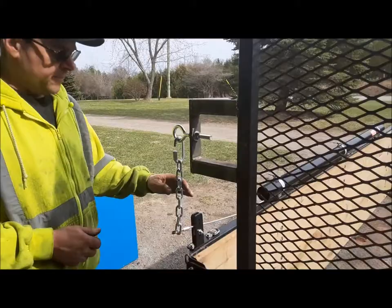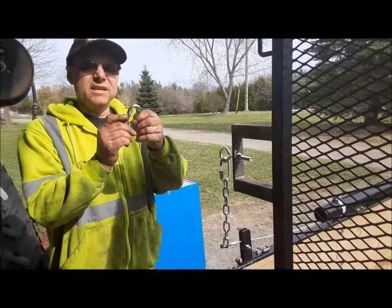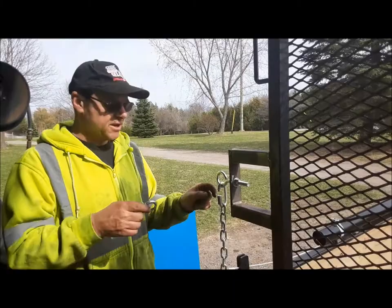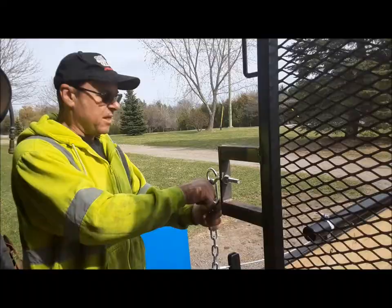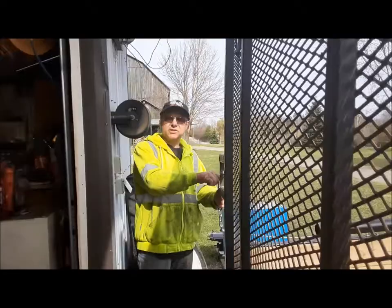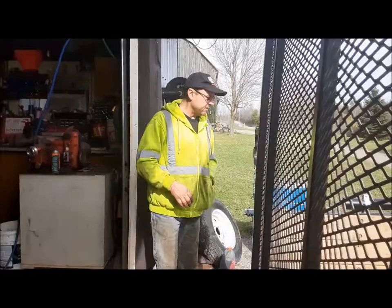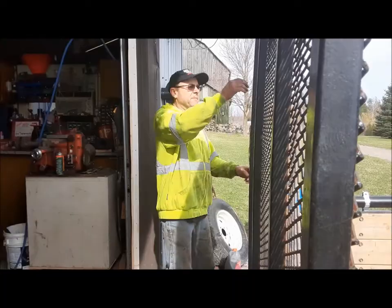We've installed the lower roller and attached the end of the chain to our eye bolt. In the kit they supply this crappy carabiner and I'm not too fond of that. At the other end of the spring they have a missing link, so I'm putting a missing link at this end just for my peace of mind — I trust that more. Now we're going to try it. I think it's pretty slack; we could probably shorten up the chain a couple of links. Basically you want to get it tight enough that it'll let the tailgate go all the way down but not pull it off the ground.